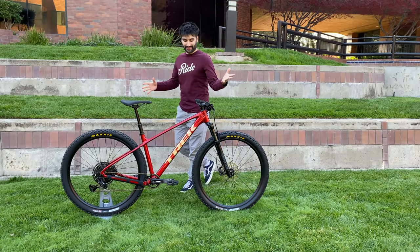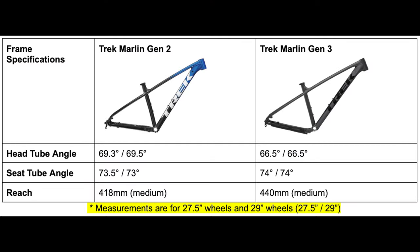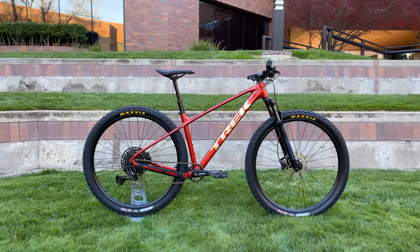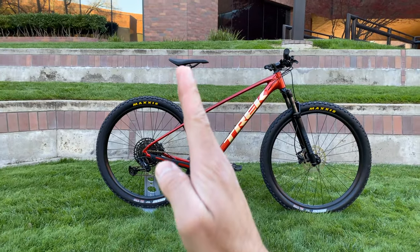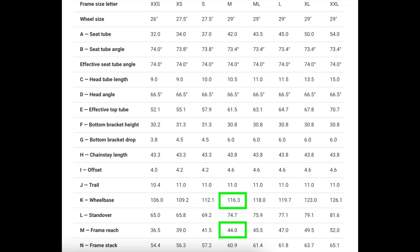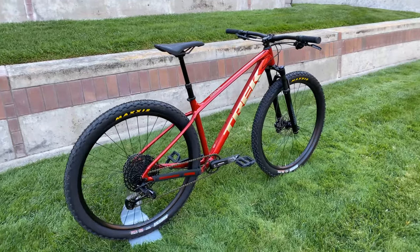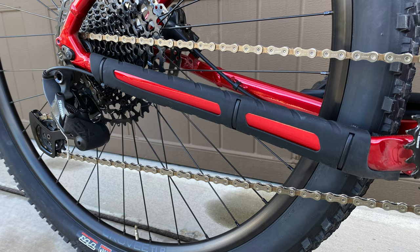For the components overview, let's talk about the biggest update: the Gen 3 frame. Trek has made this bike more of a trail-ready machine rather than the typical cross-country light trail-focused bike. They have slackened the head tube angle by a massive three degrees to push the front wheel out further, which helps keep the bike stable going downhill. They've also steepened the seat tube angle by one degree to still make uphill riding efficient. The wheelbase and reach values have also increased, so this bike is longer to inspire more confidence going downhill.